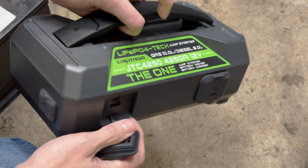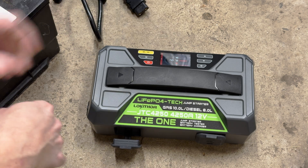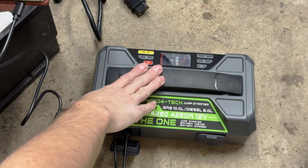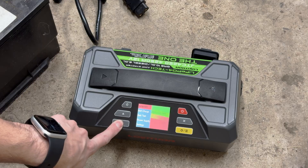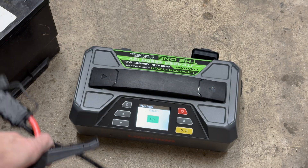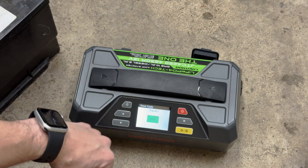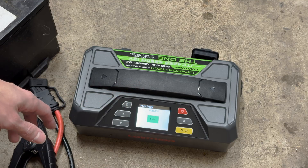Now it's charged and we can use it as a USB power bank. I'll plug in the phone — it can deliver up to 60 watts. Grab one of the included cables and get a phone that can charge really fast. Supercharging — not every phone can charge at that speed, but this outputs up to 60 watts. The power supply mode lets you output over the jump leads a steady voltage up to six amps, so you can run systems in your car without a battery. You can select from 5 volts to 20 volts and use it plugged into AC mains or off the internal battery.